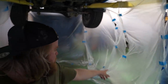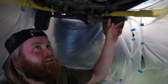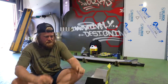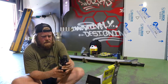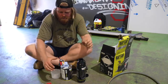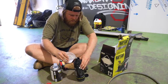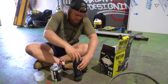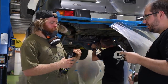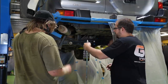There's the room underneath the car — I've just taped it all down to the floor and taped all the sides together to make a protective enclosure as best as I can. Now we're going around taping up some of the electrical components and things like that. Opened up the kit of Raptor paint — this is about a four litre kit, so you've got four bottles of paint and then this is your hardener mixer. Fill your hardener up to the line, tip it into your paint, put the lid on and shake it up. Then bust the cap off and screw the bottle into the bottom of the gun. Get a couple of test samples and see how it comes out.